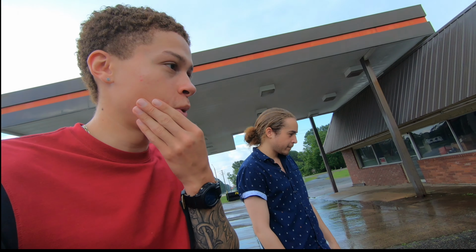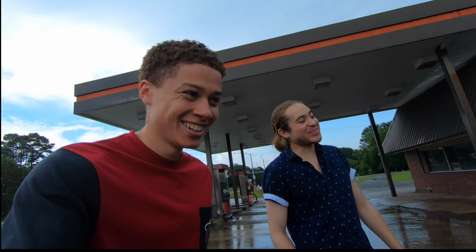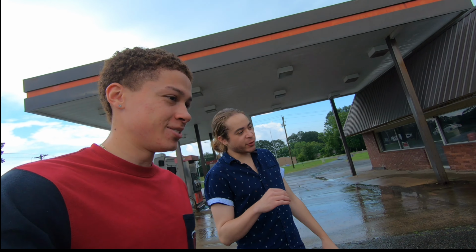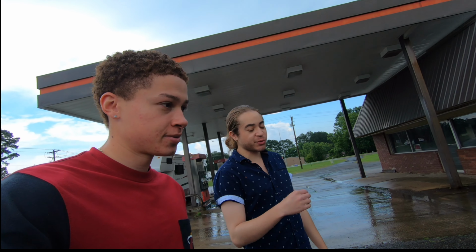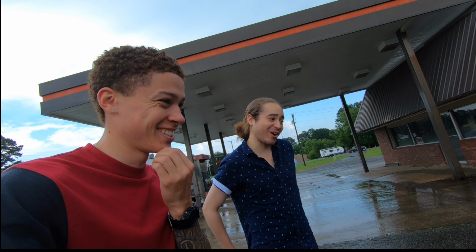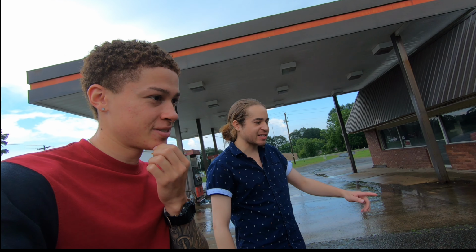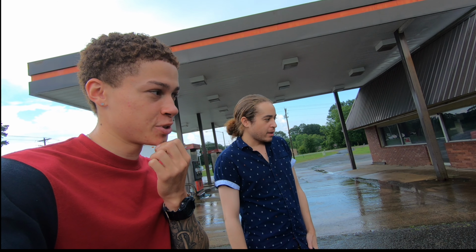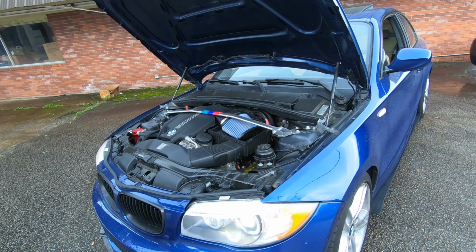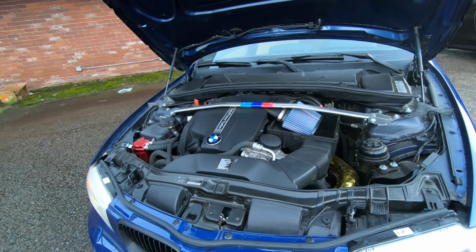Okay. So what were you telling me earlier? You have to mix it 30%. Oh yeah. So the E30, it's a weird thing, because to run E50, which is the max, you need a Stage 2 low pressure fuel pump. And right now I don't have that, so I'm just running E30. Yeah. But it gets a little tricky with the math, filling it up and knowing the size of the gas tank. Yeah, for sure. And what engine is this? This is the N55. N55, okay. Gotcha. Man, it's super clean.